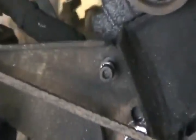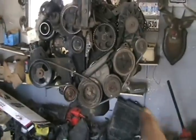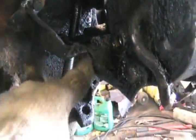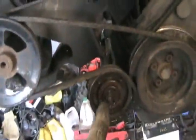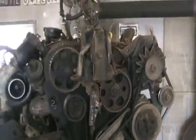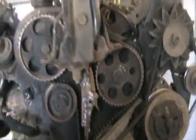I just got done repairing the broken bolt in the power steering bracket and a bit of the broken-off flange. So there's what Chrysler power steering looks like on a Volkswagen. The pump is on the opposite side — if it was Volkswagen, the pump would be right there. It's a modified four-cylinder Chrysler power steering bracket with an undercut piece in it to clear the axle when the suspension hits big bumps. It uses a Volkswagen timing belt tensioner for adjustment, or it has adjustment by swiveling the pump like a Chrysler. While it was in the air, I put a new timing belt in since that one had over 100,000 kilometers. I also welded a bit of strengthening on that motor mount that I made because I found a crack in it. Ready to go in.